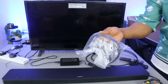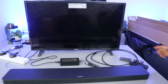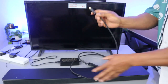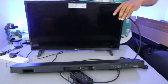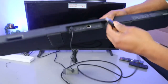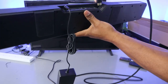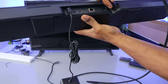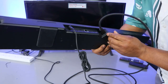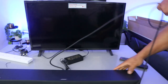Also a headphone is included for you to listen to music quietly without disturbing anyone. So to connect the soundbar to your TV, what you want to do is use HDMI first. Unplug the soundbar and unplug the TV before you start. The HDMI cable goes in here — it goes to the HDMI ARC port on the soundbar.